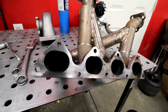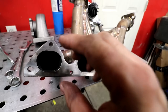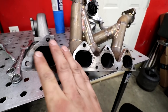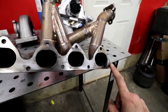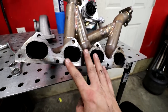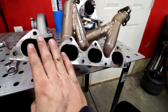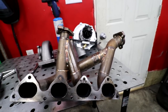That was fast. Oh, that makes sense now. There's like a little piece in here that's offset, so when you crush a pipe, you can stuff it in here and just weld the outside. You don't have to butt weld it. This should have been the outside of the flange. I didn't realize that the flange wasn't symmetrical. This one's actually up a little bit higher than this one, and this one actually has to go up, and this one has to come down a little bit. If you would have flipped it and put it the way it was supposed to be, it would have fit perfect, but these two bolts do not fit. So I just have to adjust them a little bit. I didn't want to use this side because it was not gonna work for the round pipe I was using. Dang, look at them garbage welds though.